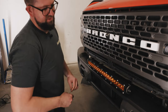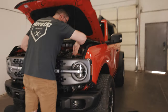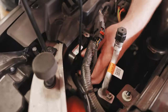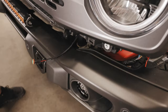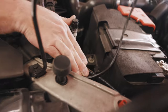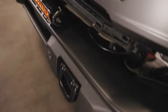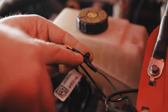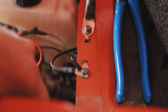With the brackets installed it's now time to install the wiring harness. Once the hood is open there's a channel that runs right behind, kind of to the left side of the headlight — we'll want to run the wire down that way. Leave a little bit of slack on the wire and run it with existing wiring up to the upfitter switches. After running the wires up to the forward upfitter wire location, make a wire-to-wire connection with the positive red wire — in this instance we chose a military splice type connection. When making the ground connection, attach the ring terminal to the 8 millimeter bolt and then zip tie the wire away from anything hot or sharp.